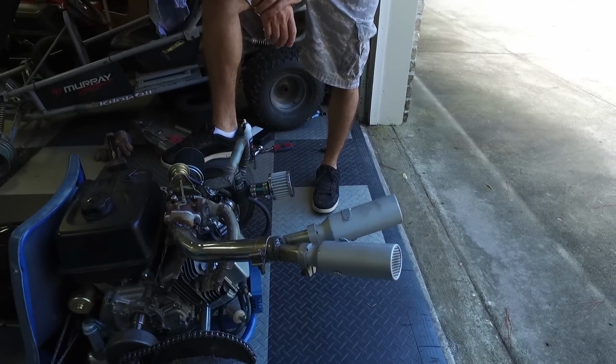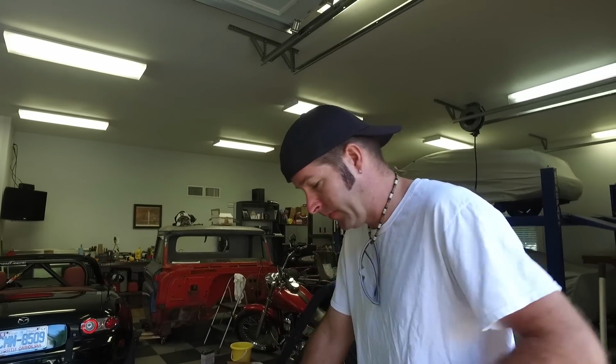That's the idea. We think we might have heard it work, but I've come to the conclusion we're not going to get a whole lot of psh out of it because it's a one cylinder engine. We don't get much pulse. The vacuum pulse is just, we don't have a steady vacuum, so that valve's not going to work correctly. So we're probably bleeding off a little bit of the pressure, but just not enough to hear it.